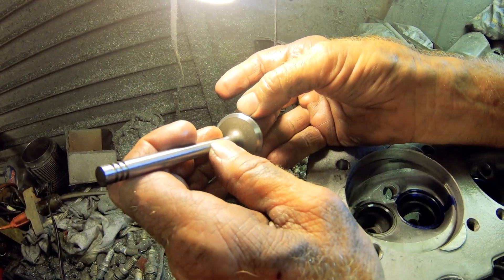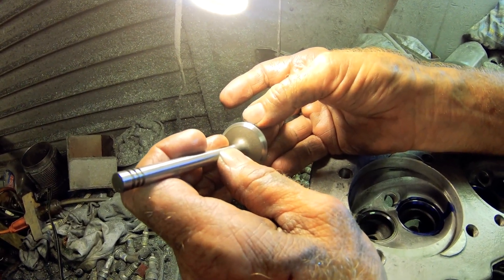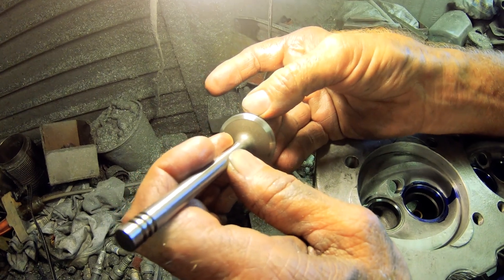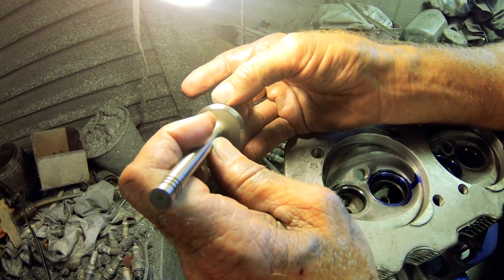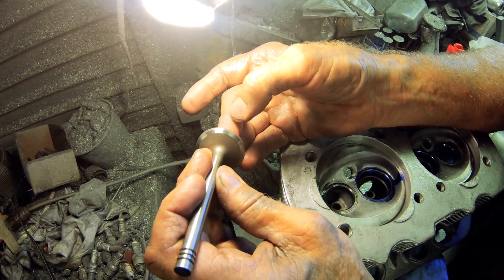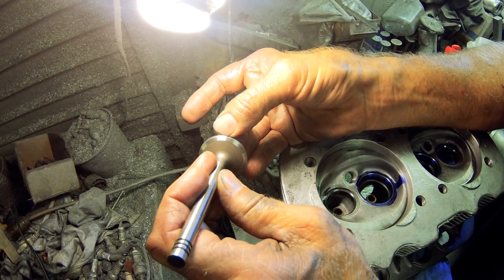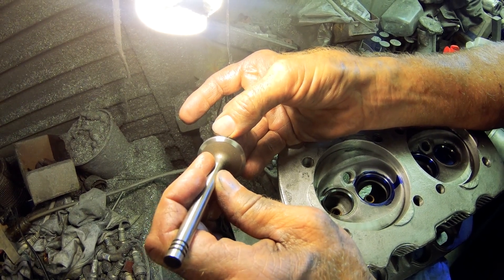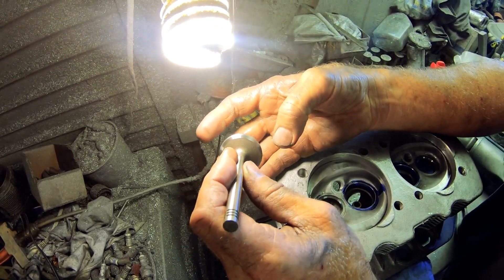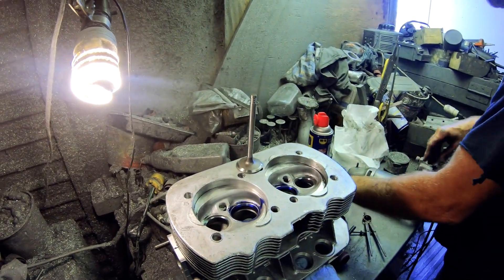You can see there's a little space between the actual line, and then the 45 on the valve and then the actual tip — what they call the margin. That's where it's printing right now, which is pretty good. For racier stuff, I like the 45 even more closer to the margin. Watch when I lap it into the seat.